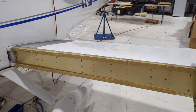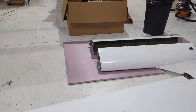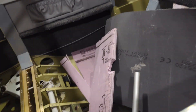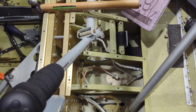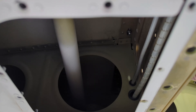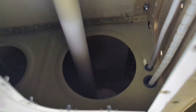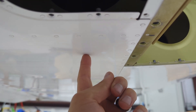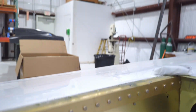We removed the tanks, and now that we've removed them we can drill and add the return line. Some other things we had to do before removing the tanks — and this is a mess, I do apologize — is we had to disconnect the aileron push rod. Doing that gave us a little bit more access in these panels. You can see it's pushed up and out of the way, and that's super important because it's really tight in here. On every other set of bolts you're going to have to reach your hand in through the ribs. There are only three access panels underneath the wing, so there is some limited access to some of the bolts, but it's manageable, and we did get it done.